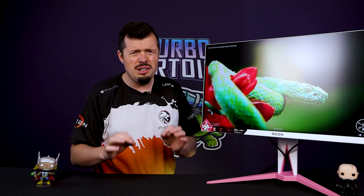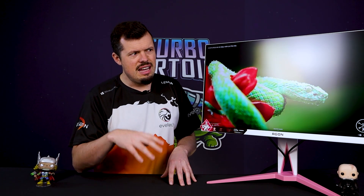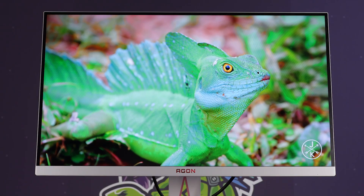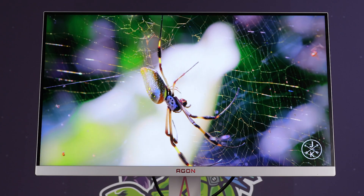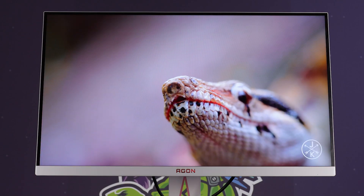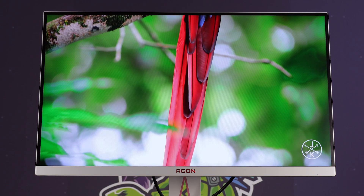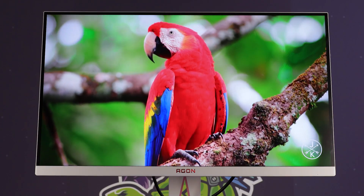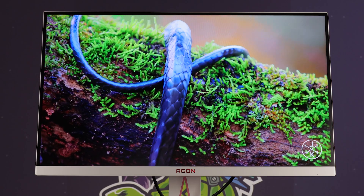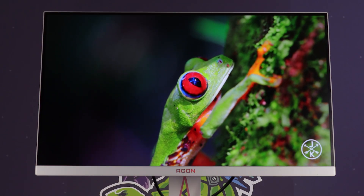Your experience with content like greens and reds and high contrast colours next to each other is absolutely superb. Out of all the monitor specs listed, there's only one that I found it didn't quite meet, and that was the viewing angle — quoted at 178 degrees. It is theoretically there, but it does glow, which is just normal with IPS. At extreme angles you can see glow around the edges of the panel, and I attribute that to the film over the top of this display — it's in between gloss and matte. But if you're dead on, or even 30 to 60 degrees off, you're not going to notice — only at the extremes do you pick up that slight glow.